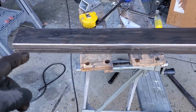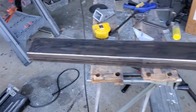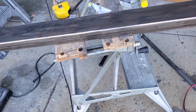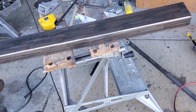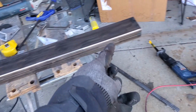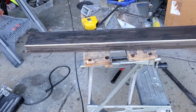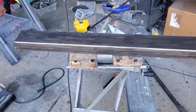So what I'm gonna do is use some steel. This is a 2x4 steel, 120 wall. It's basically what I made the main cabin out of on the Aventador. Two reasons: the first is I don't have a piece of aluminum this big, even from the spare frame, I don't have one long enough. And the second is strength. This is going to be a hell of a lot stronger than any aluminum. So what I can do is weld the engine mounts to this and then bolt this probably through the frame on the McLaren so that I get a really nice mounting and it doesn't crush the aluminum when I bolt it down. So we're going to go under that premise, give it a shot and see how it goes. Let's get at it.